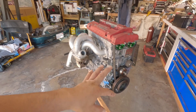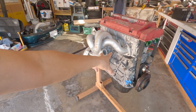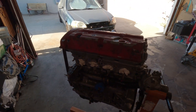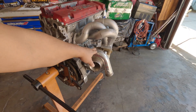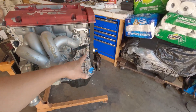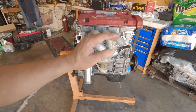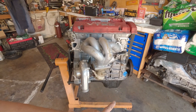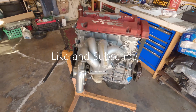Hopefully you'll find the cost and how to build this thing to be very competitive with a K-series. It will give you good power — if you like, you can get it ported, use a 70mm throttle body, and have it tuned on E85. But don't strap a turbo on it and expect OE connecting rods and cast pistons to last — it's just not going to happen. You must upgrade your bottom end. Always use a good ECU, a wastegate, and fuel injectors and you'll be good to go. Thanks for watching, I'll see you guys next time.